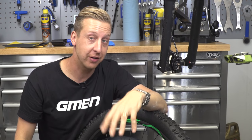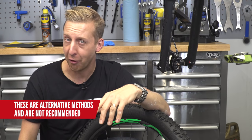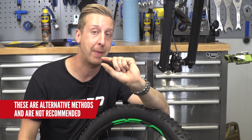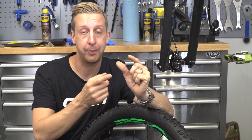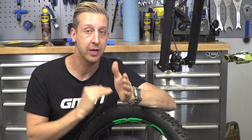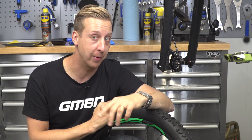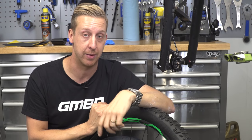There are also a few alternative methods for stopping brake pad squeal — I probably wouldn't do these myself, but it's up to you if you want to try them. A classic is to use copper slip on the back of your brake pads. This comes from the world of motorbikes and cars — the pads can vibrate, causing squealing, and copper slip on the back of the pad where it contacts the piston forms a little barrier and helps absorb that motion. Apparently it works really well, but I wouldn't be inclined to put any sort of grease or lubricant anywhere near my disc brake pads.